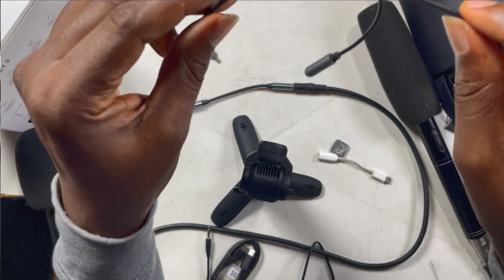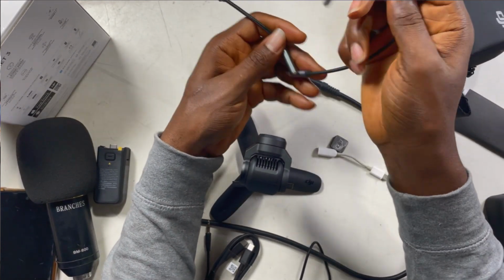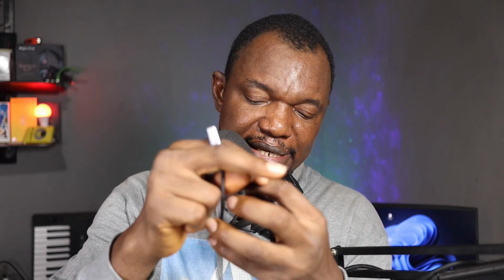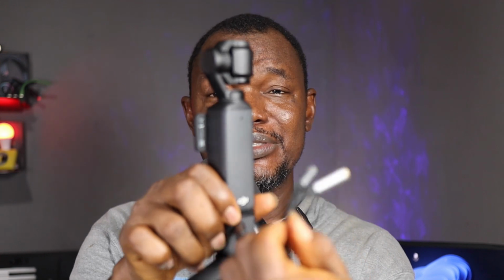Number three, with these two things, you can convert. This is a USB-C to 3.5 mm adapter, this particular one works, because the one that came with my Xiaomi phone didn't do the trick. I'll put the link in the description if you want to see this. If you connect it to this one that has a splitter for both earphone and microphone, you can now connect the DJI Pocket 3 here, and then connect any wired microphone that is using 3.5 mm. I just did some experiments and I found this out. I'll put the link in the description, so you can continue to use your old wired mic that is still good, and still enjoy the quality from the DJI Pocket 3.